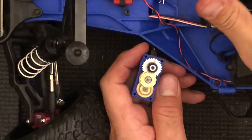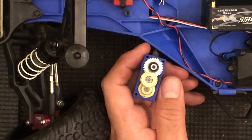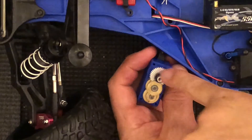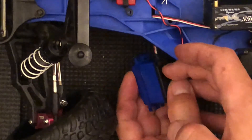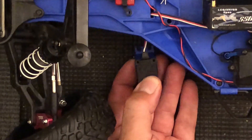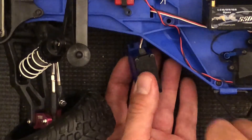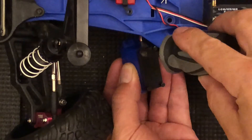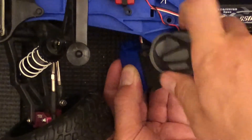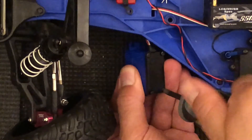Now, normally you don't want to run it this way. Let's see — running power through it. Transmitter is in neutral; this is going to be important for when I install it. That appears to be about neutral, so now I can go ahead and place this right on top. I'm going to flip this and tighten the screws — and that is it. All four screws go in there. Do not over-tighten any of the screws. The reason is it's metal going into plastic, and it's the plastic that's going to be damaged — and that's the servo case. Don't want to damage that.